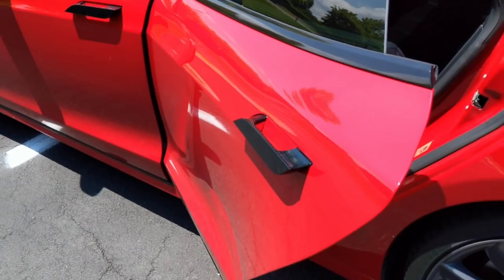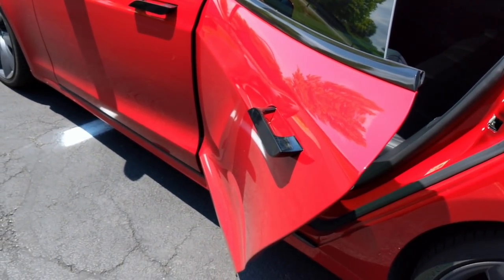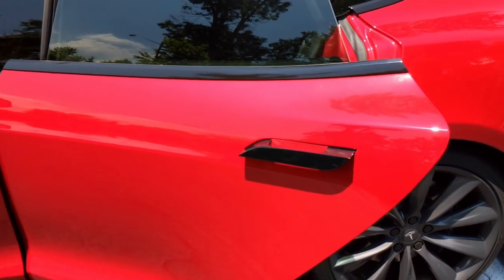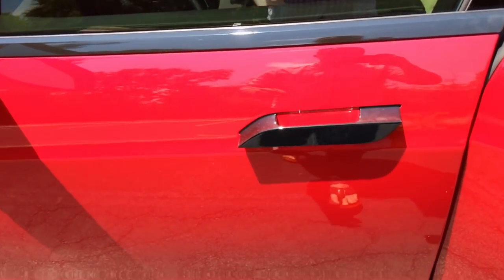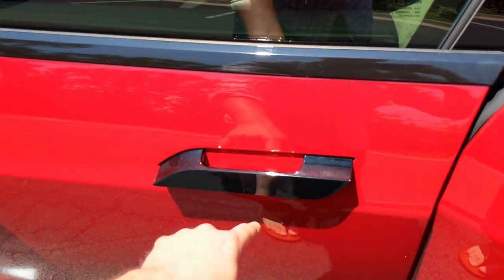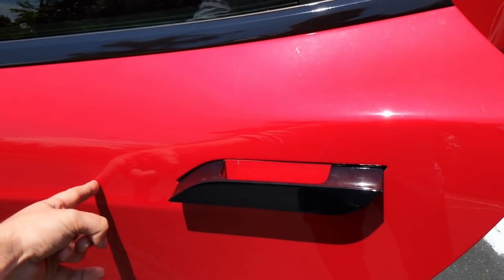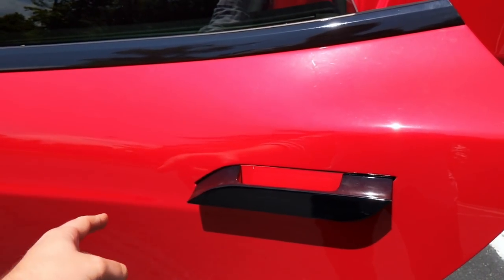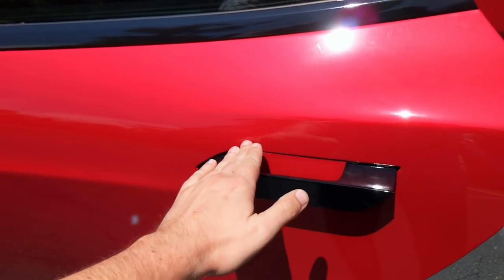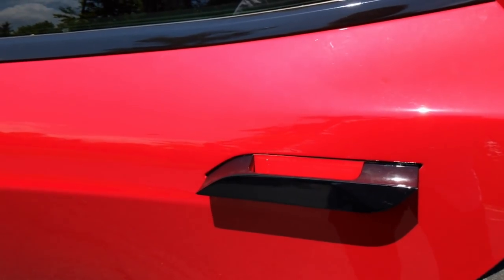Door handles — they aren't as difficult as they look. I thought this was going to be the most difficult part, but it wasn't too bad. I wrapped this first handle differently than the other three — I learned on this one and improved. I started off wrapping the front face and then wrapping up to meet the curve. While it works, you can still see a little bit of silver — I'm going to rewrap that one. On the others I took a piece of vinyl with about three extra inches on either side, started on the top edge with about an eighth of an inch extra on top, laid it down flat so this face is nicely glassed out, then stretched it over the front until that was glassed out too. You can do this whole piece without any heat — it works out quite nicely.